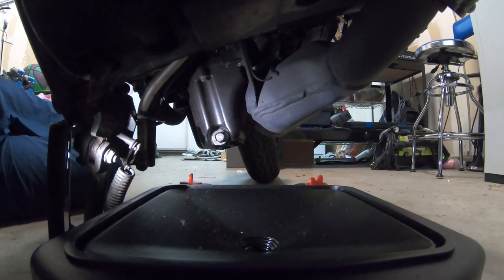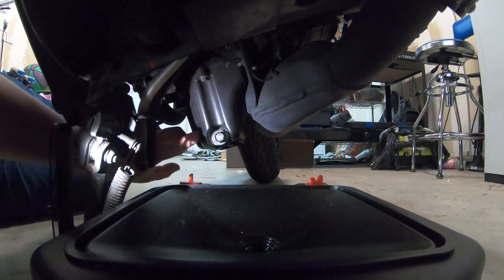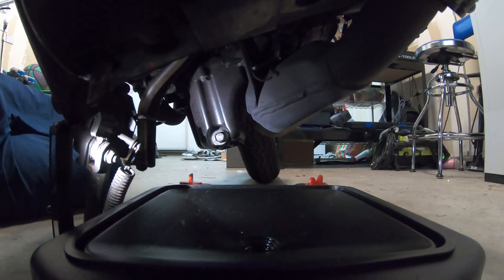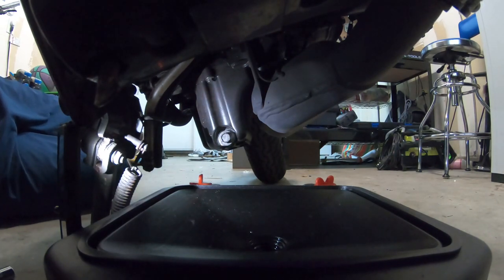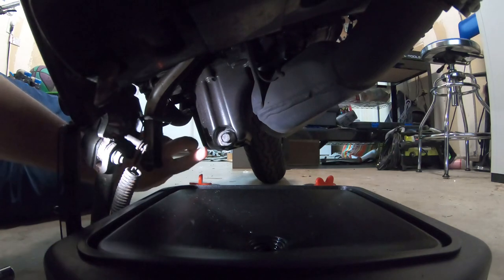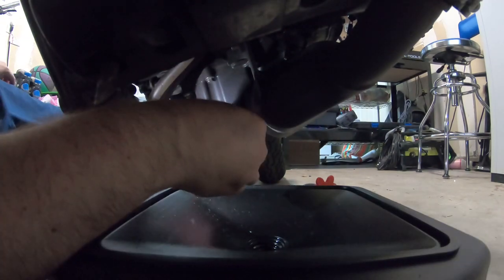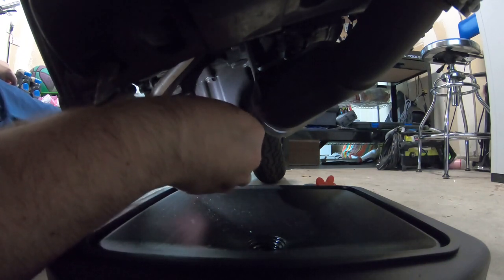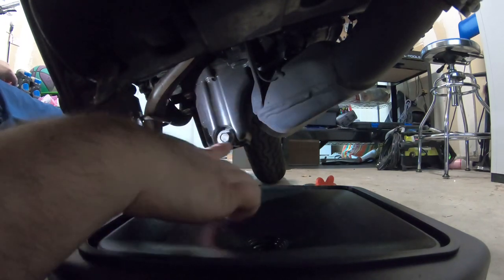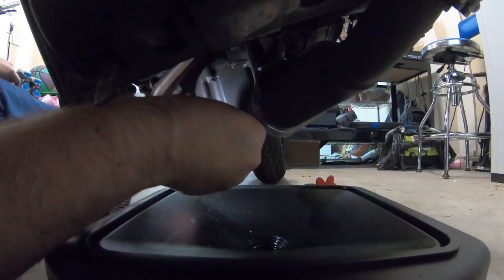Here we are underneath the bike — I'm laying on the left-hand side with the front wheel up that way and the rear wheel back towards the camera. This bolt right here is your drain bolt; this is the one you're going to remove to get the engine oil out. Now that our bike is warmed up, I'm going to take my 12-millimeter wrench and go ahead and break the seal. It shouldn't take too much force to get this off — if it does, it's probably been over-tightened. Just spin it the rest of the way off. There's an aluminum washer on it as well, so make sure that as you're unscrewing it, you keep a good grip on the bolt — you don't want to drop it in your oil drain pan.